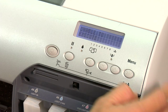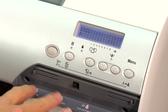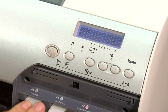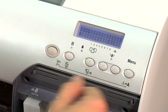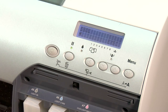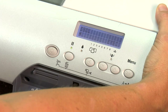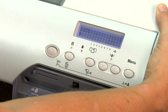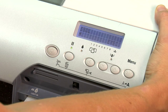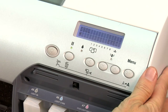Press your menu key again. If it says 'unable to execute,' that usually means you have a cartridge that is a little too low — you need to have enough ink, at least three bars. Or it means that your maintenance tank, located below your cartridge on the front side, is almost full. It will not let you execute if any cartridge is empty or your maintenance tank is near full. So make sure you have enough ink and your maintenance tank is not full before doing this cleaning.